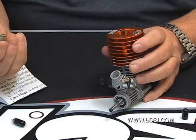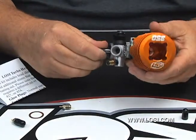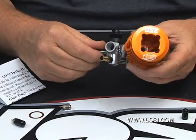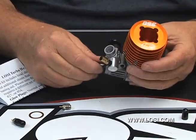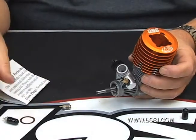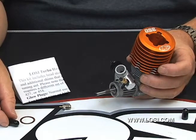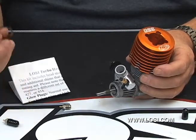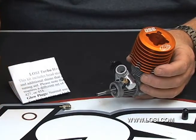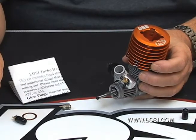All you need to do now is install the glow plug into the motor and you're ready to go. You can expect to get a little bit better acceleration and considerably more top end — it should be noticeable, especially when you run the higher nitro fuels. We also give you this extra head shim, which as noted in the instructions, if you run in a real damp or high humidity area you may want to try adding that to retain top performance. And we give you an extra glow plug so when the time comes, you've already got one sitting in your box ready to go.